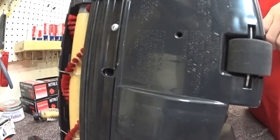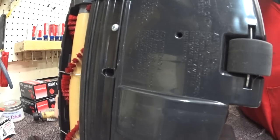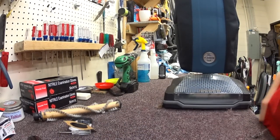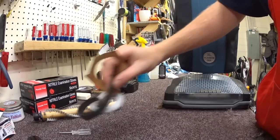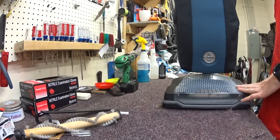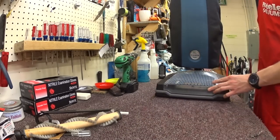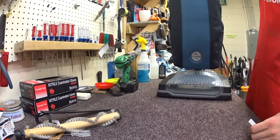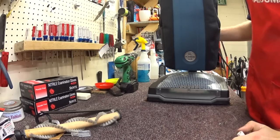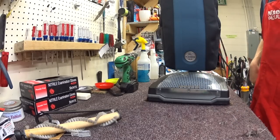I've got one screw left. We changed the gasket, the belt, the brush roller, and the micro-sweep. We're going to turn this bad boy on — if it's working right, you'll see that this will walk away by itself. That's when the belt's good. When it stops giving you that feeling, it's time to change the belt.